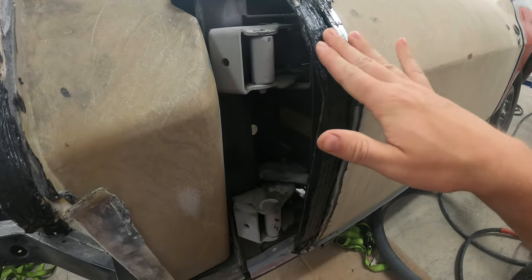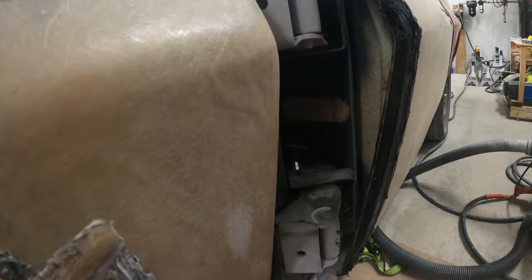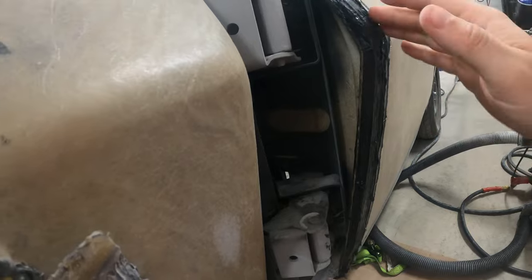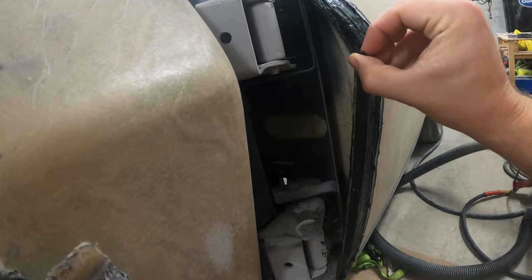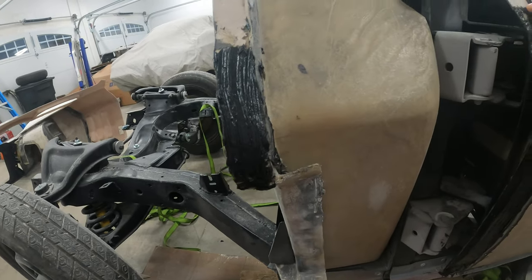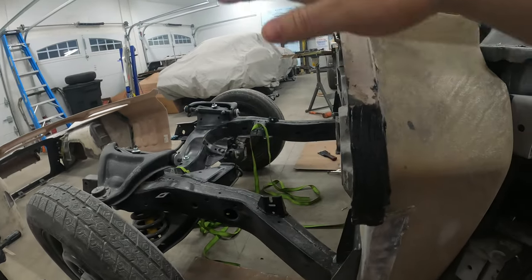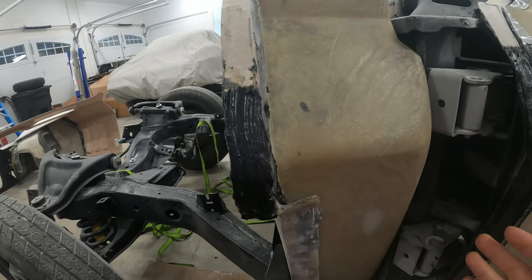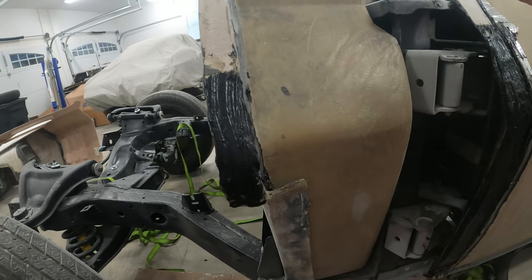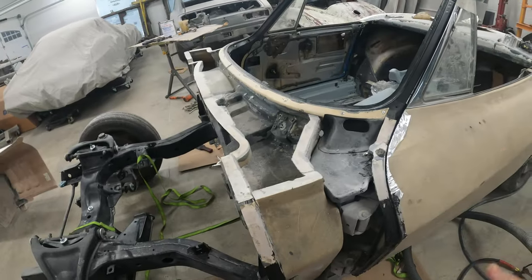I mixed up some bonding adhesive to fill this gap and brought it out to the level of the door — a little bit high is better than a little bit low. Now I'll rough this up and knock it down so it's about a tenth below the door, clean up all these loose random chunks. I also added some on the plenum. We're installing a hand-laid front end, so there won't be the bonding strip that bonds the fender cap down to the gills — that's on a press-molded multi-piece front end. Once that's sanded up nice, we should be able to test fit the front end hopefully one last time.